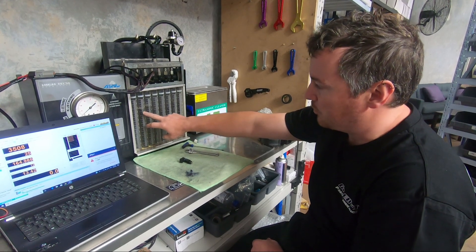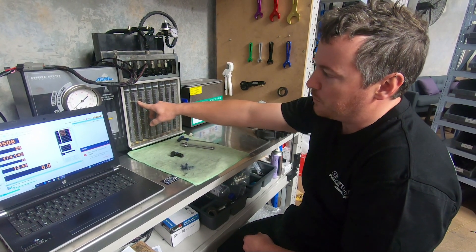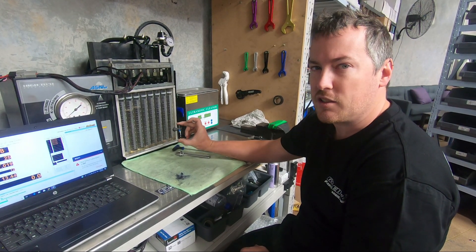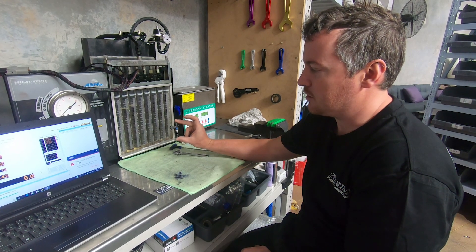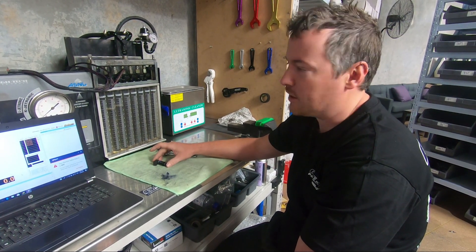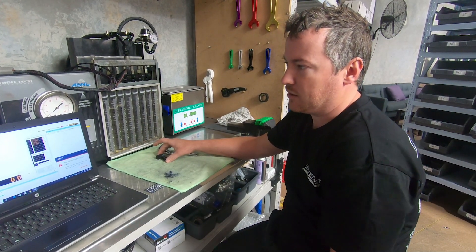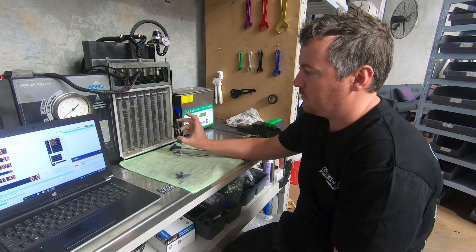For an example with these blue ones, we split them into three groups — lowest, middle, and highest — so within a matched set you're within two percent across all conditions, not just fully open. For a set of six injectors we charge ninety dollars, so fifteen dollars per injector. A full day we might get six or eight sets done. People supplying injectors as color matched without a data sheet is the same as our off-the-shelf ones, but we also offer this extra service for those that want a little bit more security. That's all — thanks for watching.